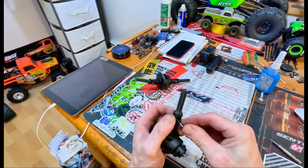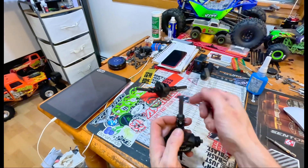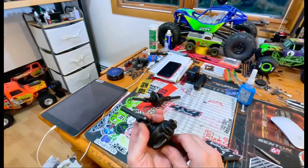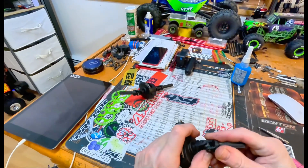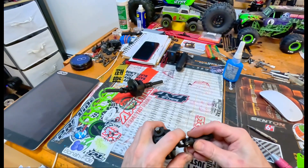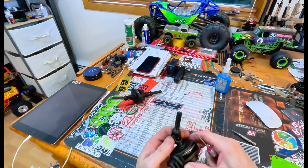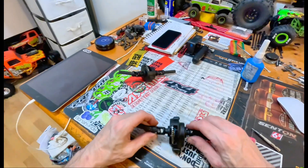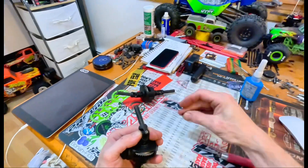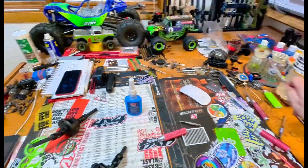Then it's just a matter of lining up your holes and pushing it back in. Aluminum versus steel — aluminum will bend before steel. Don't feel too bad about using a little love on aluminum. Steel on steel, not so much. Keep it aluminum on steel — the softer will always bend, that's the general rule. Slide this side in, line up the halves, put the hole in it. Square up the extra to be even between both sides, then run your grub screw in. You're done — Loctite the sucker in. You don't want it falling out, trust me. Be like every other guy out there: 'Oh man, my wheel fell off.'